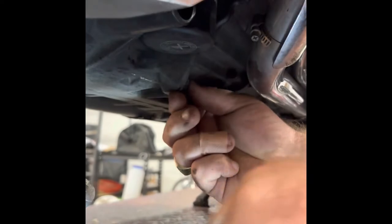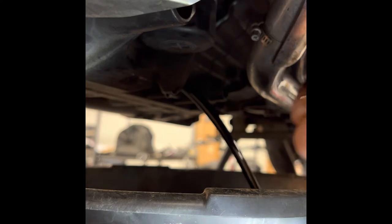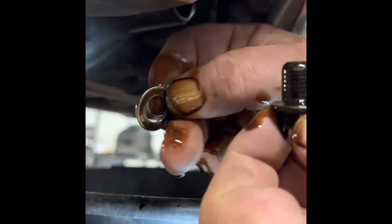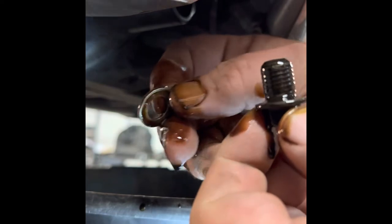Let's start with the one on the side. Break it loose with a ratchet. You're going to get it all over you, because it's an oil change — no problem. Each one of the drain plugs has an aluminum crush washer. This crush washer should be replaced each time you do an oil change. There are three drain plugs, so make sure you get three new crush washers.